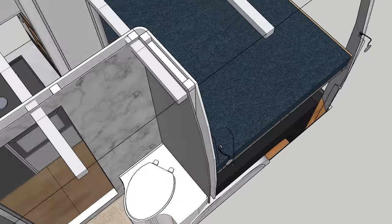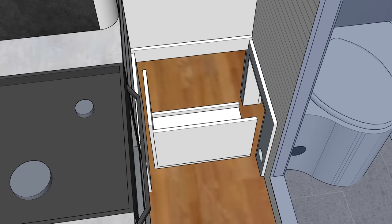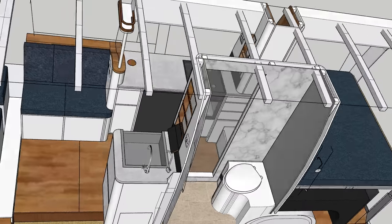Using the example of eating too much fibre — the last thing I want is to have to carry the composting toilet through the kitchen area. A much better alternative is being able to empty it from the back of the van through the garage. So the step contains not only the laundry basket, but also an access hatch into the underside of the toilet so the bucket can be removed too. The seal will be very airtight, and there'll be a built-in fan in the toilet so there's no build-up of fumes.